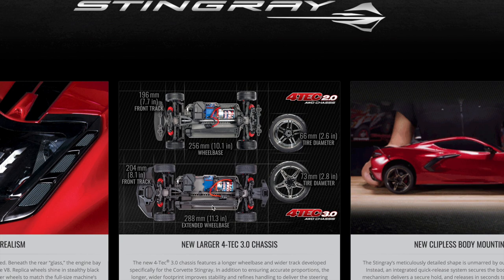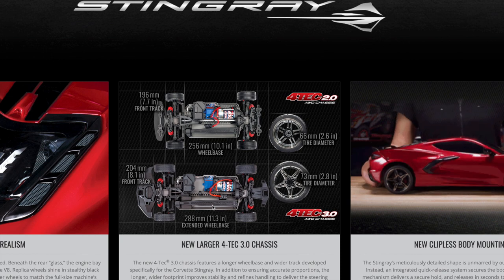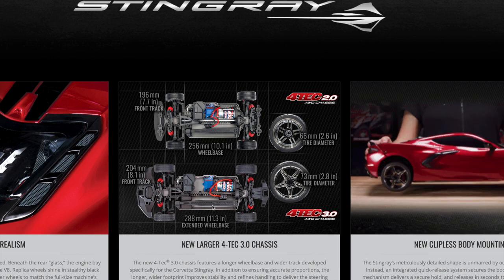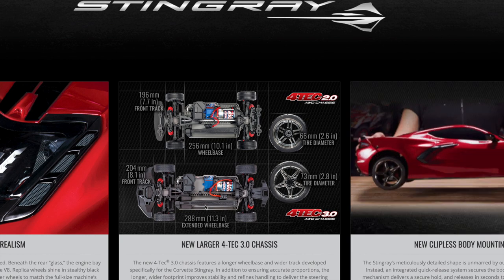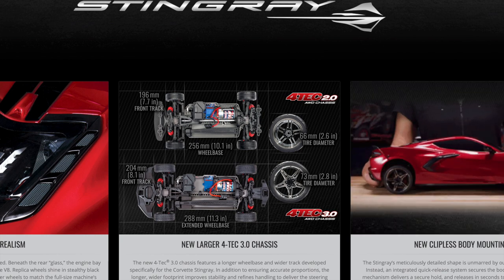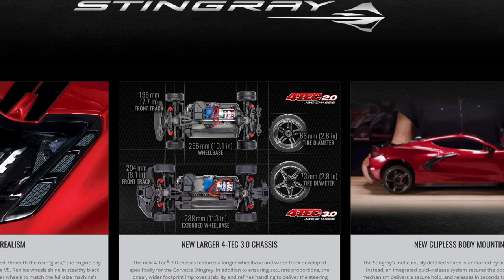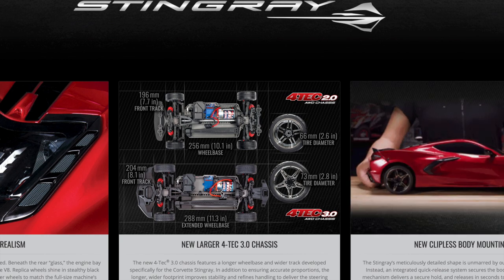To run two shorty packs — shorty packs can be anywhere from approximately 91mm to 95mm — if you have two packs that are the same, you could fit one pack here and another pack there and run them in series. I'll explain that during the math portion. The reason this is cool is you could also install a Hobbywing Easy Run system in here, which is a short course system. You can install a short course system here too.